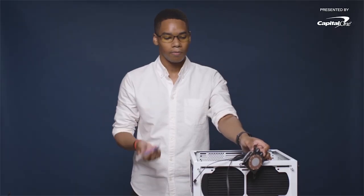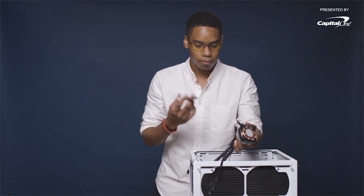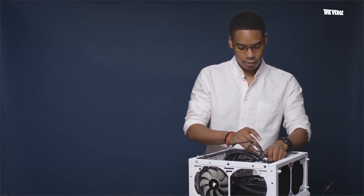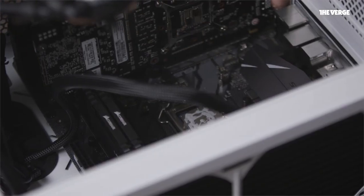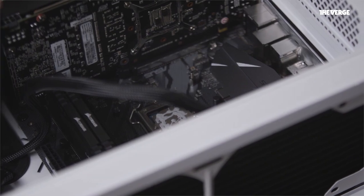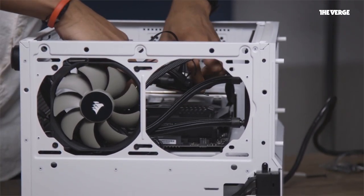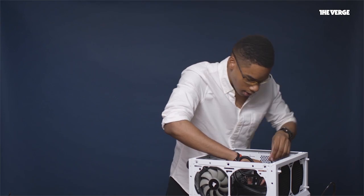We're about to apply thermal paste to the CPU. Every CPU cooler actually comes with a bit of thermal paste already applied, but it's usually not enough. Most CPU coolers will come with thermal paste — if you are not looking into overclocking, what's already there will work just fine. If you ever need to apply thermal paste, all you need is a pea-sized amount. The final portion is to add the CPU cooler to the top of the processor. There are four screws with brackets and holders that are going to keep the cooler raised off the processor, but close enough to physically come in contact with it and keep it cool. Take thumb screws and just screw them on.